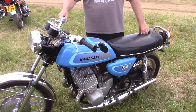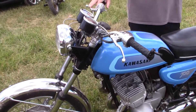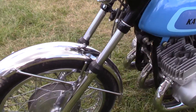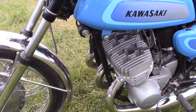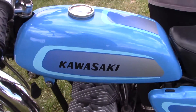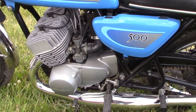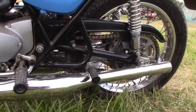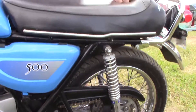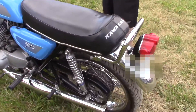What have you done to this one? I basically powder-coated the frame, built the motor, painted it — just about everything. Took the gauges apart, put new faces on the gauges, did some motor mods to it, put squish bands in the heads, put some velocity stacks on the intake, and we've got Spec 2 pipes on it.